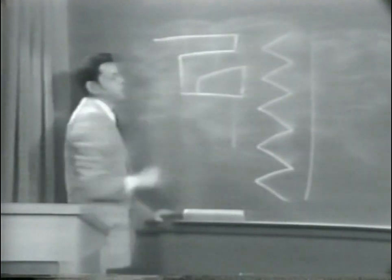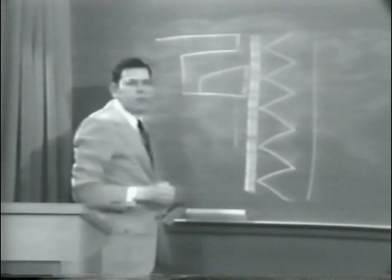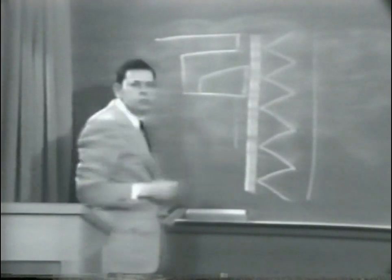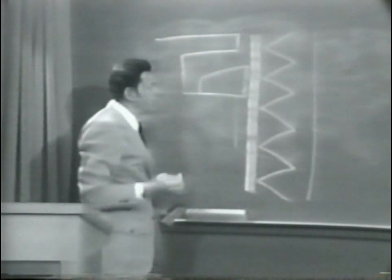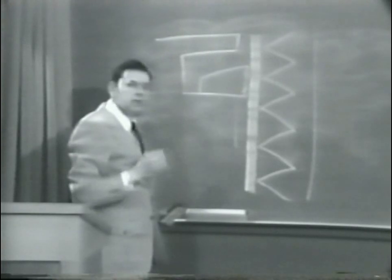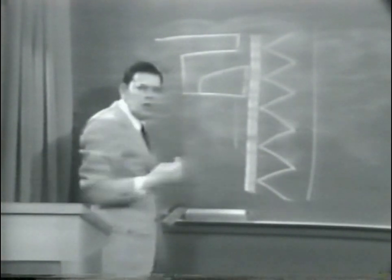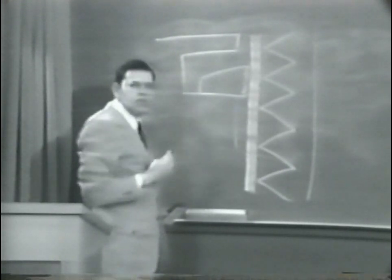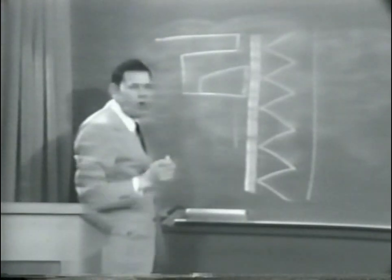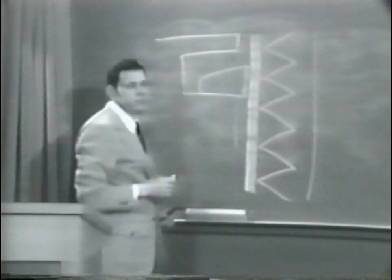In order for that ring to take the same shape that the cylinder wall has and wear it so that you have a good engine that uses very little oil and has a good gas-tight seal, it is necessary for this piston ring and cylinder wall to mate each other. In order to get that to happen, this piston ring must break through that oil film — rupture it — and make metal-to-metal contact with the cylinder wall. Startling, isn't it? But that's the way it really is. That's true in your automobile engine as well.